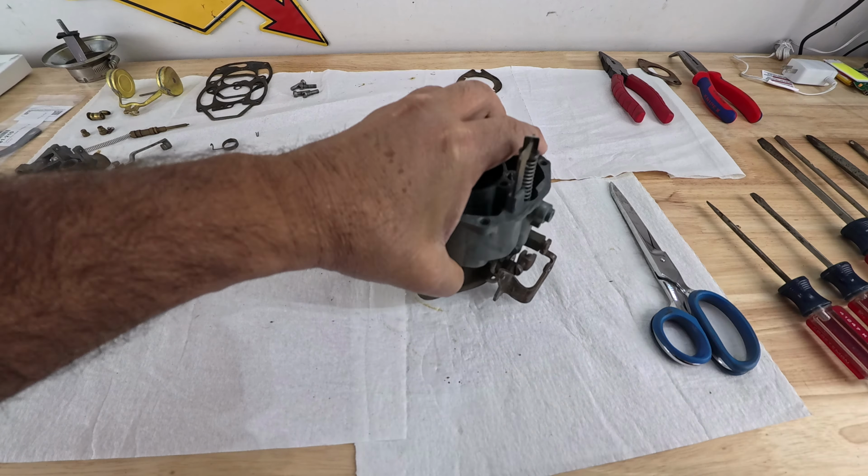It had this one and then this one over it, kind of like that. Was it like that? No, it was like this. Okay. But it only requires one type of gasket. This is for a different type of carburetor, but the reason we had two here is because I read some articles that between the float bowl and the air horn, there are leaks. These type of carburetors are known to have leaks, so that's why people put both types of gaskets in. However, only this one is required because this one is built specifically for this carburetor.